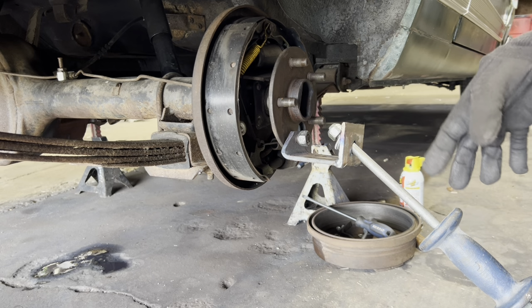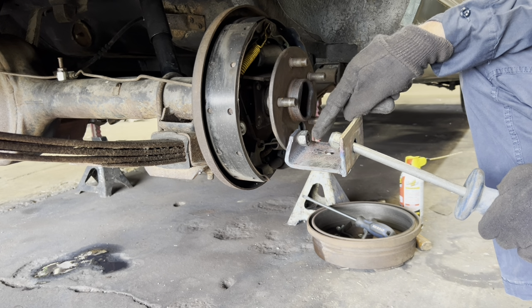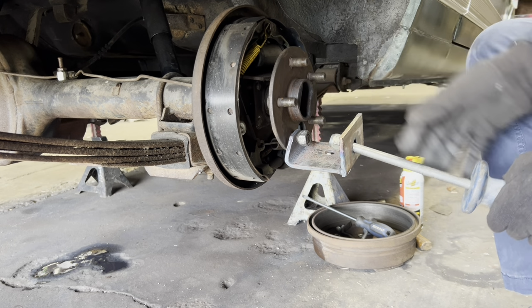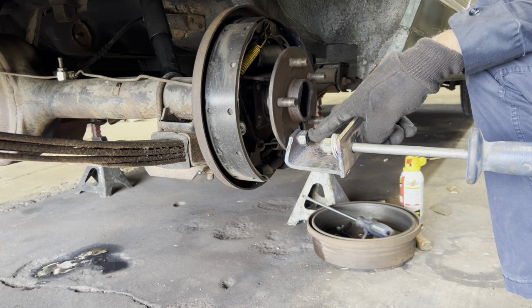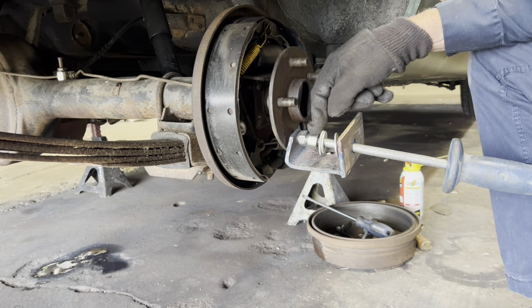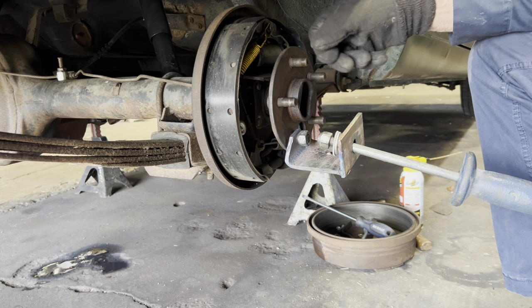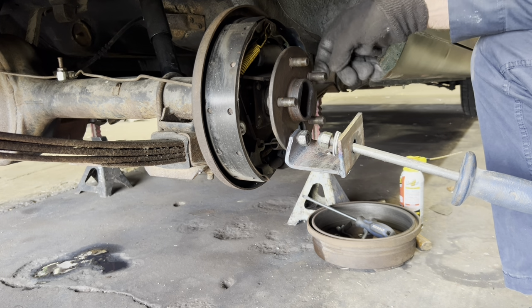Okay, kids. Here we go. Now what I want you to do, if you ever make one of these, screw this lug nut all the way up to where the threads are all the way inside that lug nut. Because if you just start it, maybe tighten it a couple of threads, when you go to bang on that thing, bam, it's gonna pull the threads off because you don't have very many threads holding. Same on this end with this dent puller. You gotta screw it all the way up, get all the threads you can on this and this, these two lug nuts. And then you can bang on it and it should come right off. You might have to change it, go up here, bang, a little bit. It takes some time, you know, a minute, but just swap around.